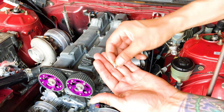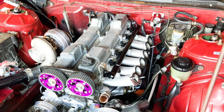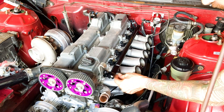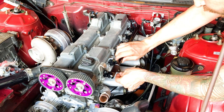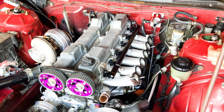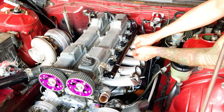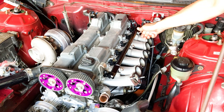For my setup I use a 3 millimeter washer in between the fuel rail and mount to fully secure the rail without any play. The thickness of the washer will change depending on the length of injector you purchase. In my instance I bought the shortest injector length, so I ended up needing a 3 millimeter washer.